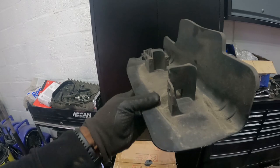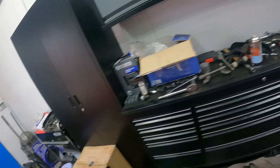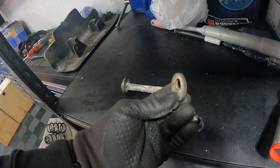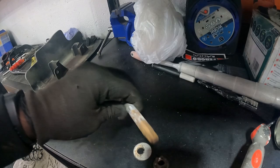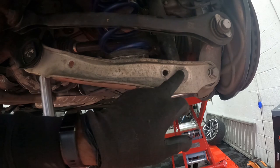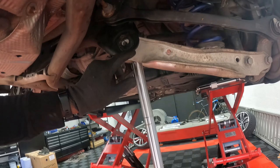Just wanted to mention: when the car sits on there, we take out the little grommets from there — just pull towards you and then pull it down and it should come out. The rear is a bit easier than I initially thought. Once this bolt is out — this is the camber adjuster — there's a little groove there, so make sure they are aligned correctly when installing it again. You don't actually need to remove the lower damper bolt, just this one part, and there's enough room to drop the assembly down.